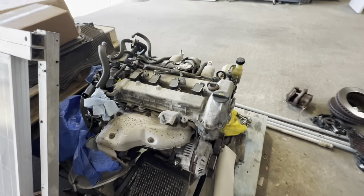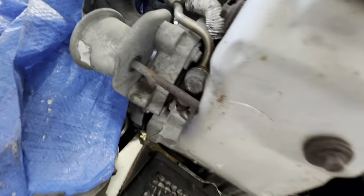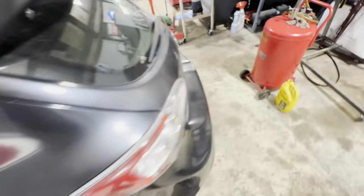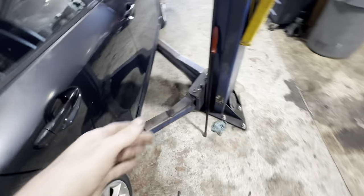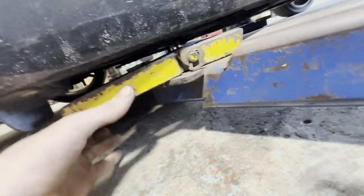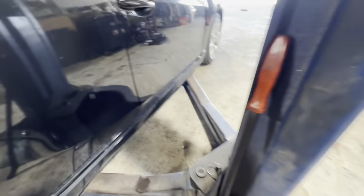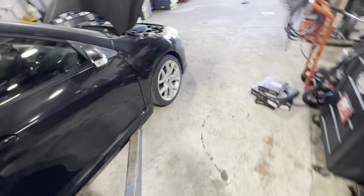This one does not have the turbo on it, I do not believe. Oh yeah, it does — she's got the turbo right here. So we don't have to swap the turbo out. Now the scary part is how much oil or metal debris may or may not be in the oil. Since this is turbo powered, there's probably some oil feed lines to that turbo, and if that's full of metal, our turbo bearings might not be in the best condition. The due diligence must be performed to make sure we don't have to do this job again for $3.99, because I love my job, but not so much to do it twice when I got to pay for it.